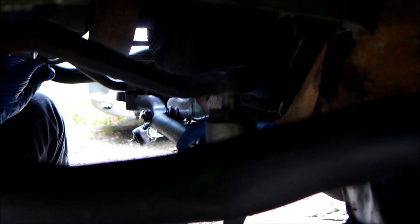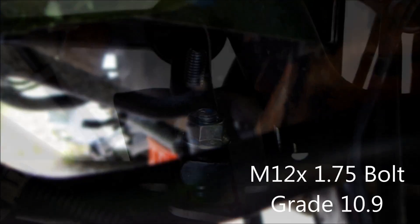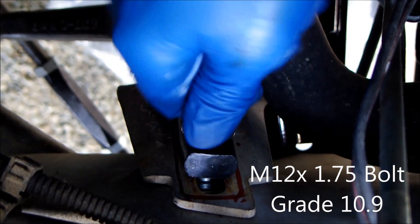This is what the finished assembly should look like. Connect the assembly to the pitman arm. A torque wrench won't fit in this location, so just try to torque it down by hand. Install the cotter pin. Reinstall the idler arm, making sure that you line up the new idler arm with the red marks made before.